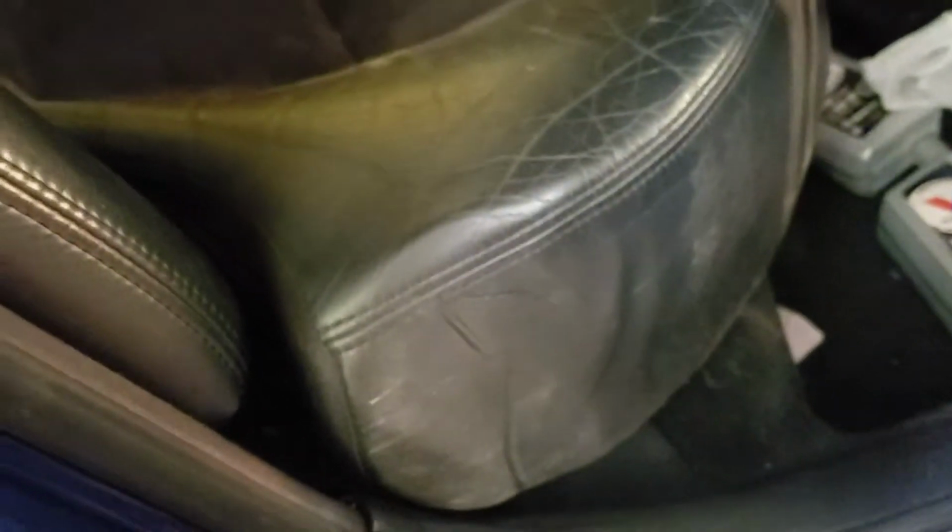So then I ran the cable along under the seat belt. Again, you can't see it because it's all back together, but if you take all of this out the same way, it just all unclips, pulls out. Seat obviously unclips right out. You might be able to see. No, you can't even see it. It's tucked behind here. So it comes up, and about right here, there's a hole right behind this seat that leads into the trunk. So then you just feed it through.